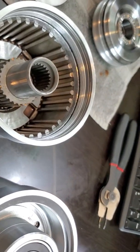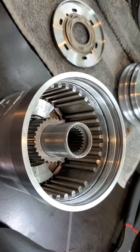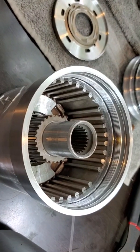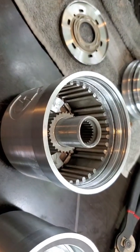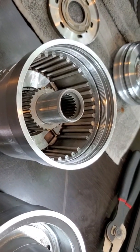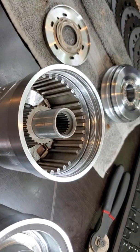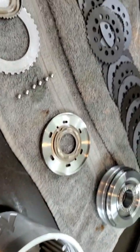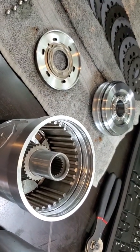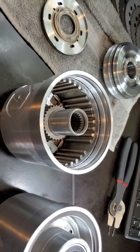So far, we've had two failures from Fastest Edge due to various shimming issues — we did not have enough preload set, so we fixed those. Now we are beginning the final test, and we are very confident his coupler will kick ass and allow him to see the full amount of the 600-plus horsepower Ford Edge dropping the hammer on the streets. This is Spencer Hoyt's coupler — I'm going to reassemble it and kick it out to him with the new shimming efforts, and he is going to test it on his bad-ass Lincoln Continental.